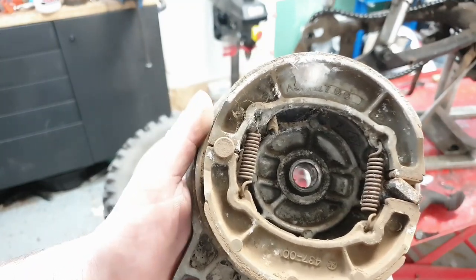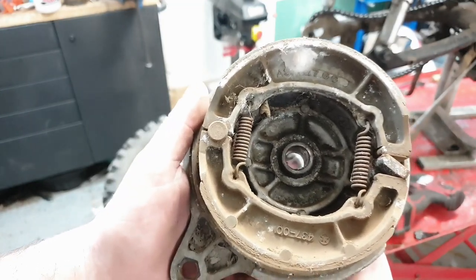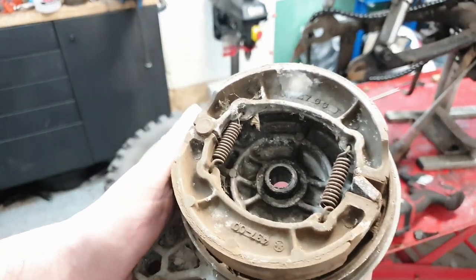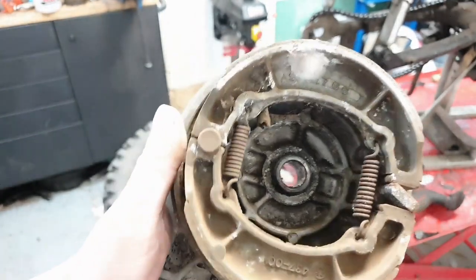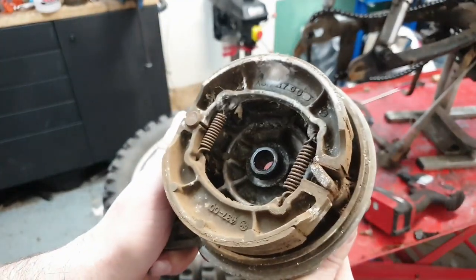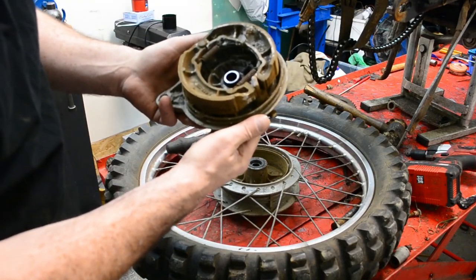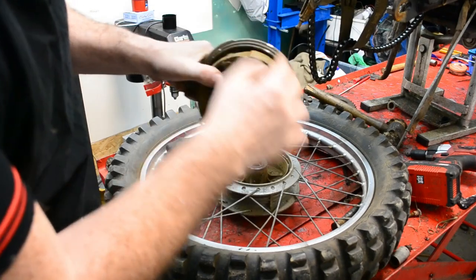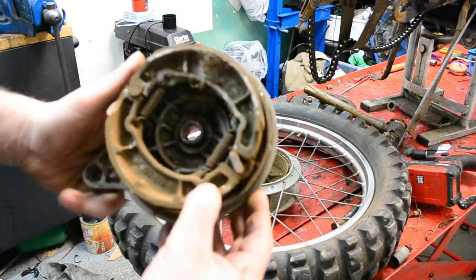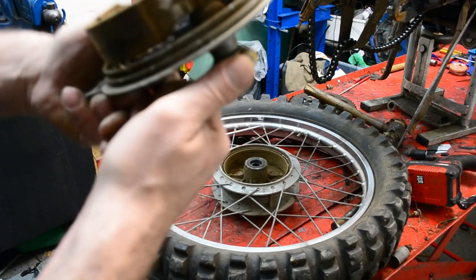If you don't maintain them every fortnight they'll be full of dirt, and the dirt can't go anywhere because it's inside a drum. Then they hold water, which turns the dirt into mud, which may as well be grease - so you've greased your brakes, and that's exactly what you don't want. I might make a decision on whether I'm going to use those brake shoes. They've got to do 500 miles around Scotland and then that's it - you need to put a serviceable tyre on and make it move.